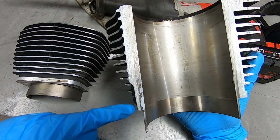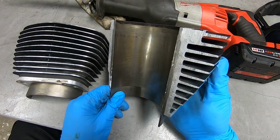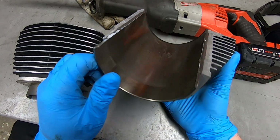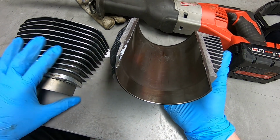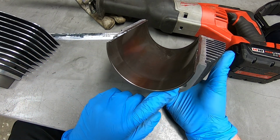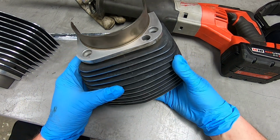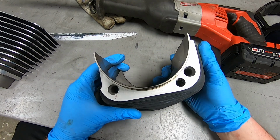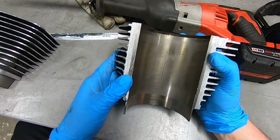This is pretty awesome. And there's a little bit of white paint left down here just from the saw blade, but you can see these are 110 cylinders like I was talking about before, and they're stock Screaming Eagle 110 cylinders. The only difference is that they're cut a little bit differently down here for a quad seal or a square cut seal that fits at the bottom for the base gasket and the main oil drains, where a normal 88 or a 103 or a 96 twin cam would have a regular O-ring. But I would imagine that the cylinder construction is the same.